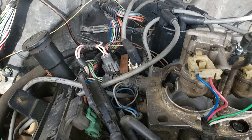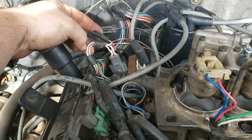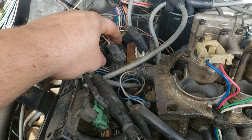I don't know why, but whenever I was doing the motor swap on this, I unplugged these two connectors here at the coolant area and the fuel pump stopped running. So check these connectors — whenever I unplugged it, the fuel pump stopped running.